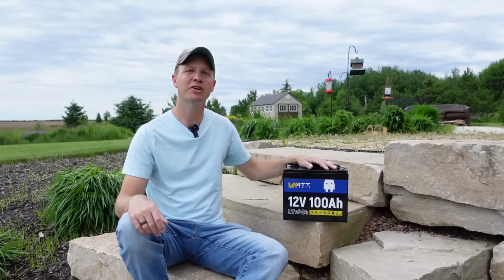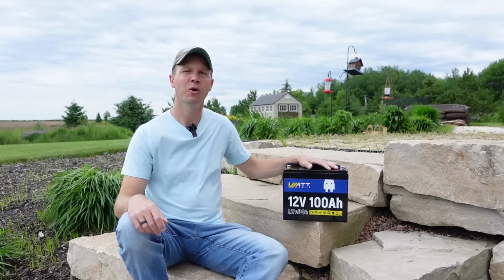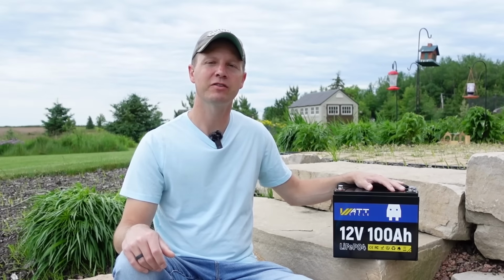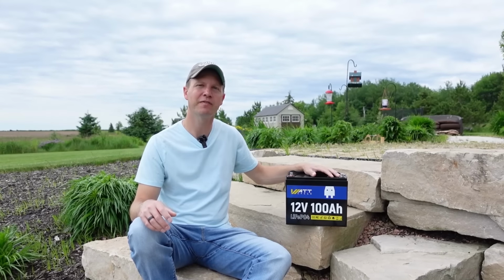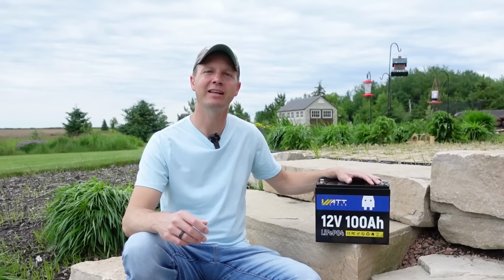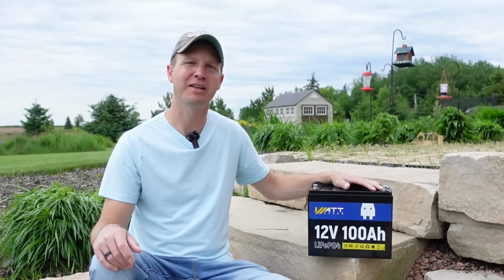For reference, the temperatures were averaging between 70 and 75 degrees, and the skies were clear with a few occasional days of overcast and some rain showers. I had the refrigerator set to around 40 degrees with the 2 LED lights turned on the whole time. Now you do have to take into consideration that the refrigerator was never open during the recording process. In real life scenarios, you're going to be going in and out of the fridge grabbing food and drinks, which is going to shorten the overall runtime of the battery when you're not connected to solar. But still, a day and a half on a battery with no solar is pretty impressive.